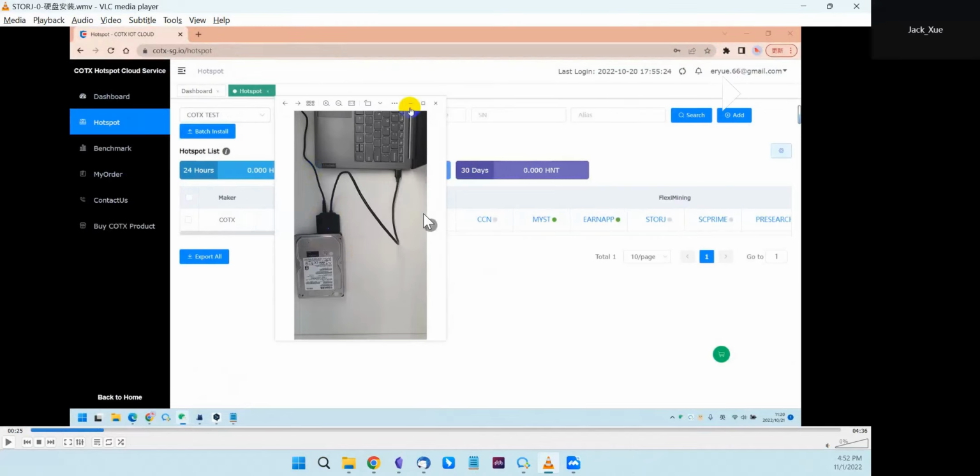and when you try to connect your hard drives, you can use a SATA interface. In this example, a SATA USB converter. You have to connect this hard drive by this adapter, like a SATA to USB, to your laptop. And we're gonna install a software on your laptop, on your PC, to format the hard drive.